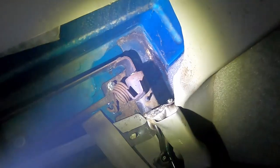Doesn't look like it's coming down from the side windows, which means it may be coming from the back glass. Got a little bit right there. A little bit of moisture back there along the edge of the seam. Still not seeing anything in the front floorboard, which is where the majority of the water was in the carpet, at least before I took it out and discovered all the other issues it had, how everything was soaking wet. Not seeing anything up there yet. We'll just hang out a little longer.